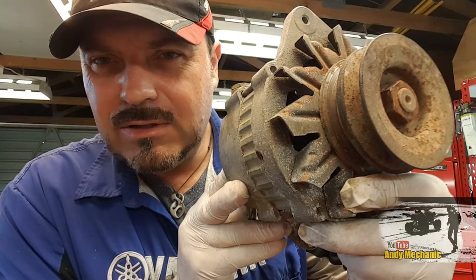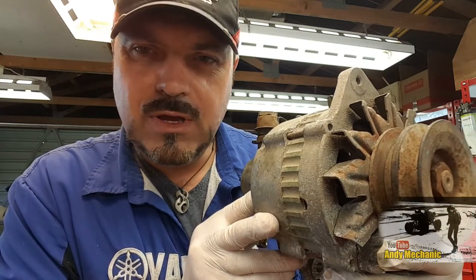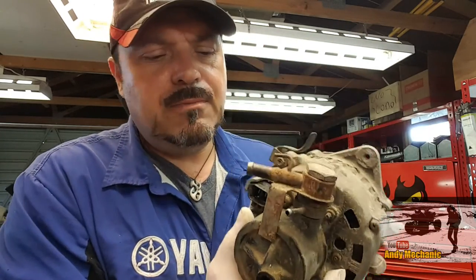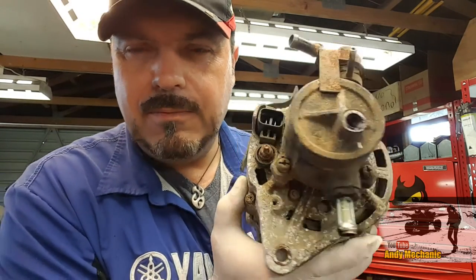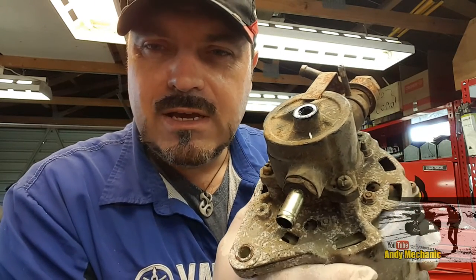I've been rummaging around under the house and I found an alternator. This alternator was part of my original spare parts that I brought from the UK with that truck when I drove it through Europe — we did 6,000 Ks in the middle of winter through Europe, so we obviously needed to make sure we had a few spare parts with us. Now on the back you can see the vacuum pump mount. This one has a pump on the back, and the one on the vehicle also has one, so I'm going to leave that alone. But if you're changing an alternator and the replacement hasn't got the pump on the back, you'll need to swap that across as well — it's just these three bolts on the back.